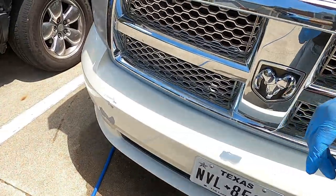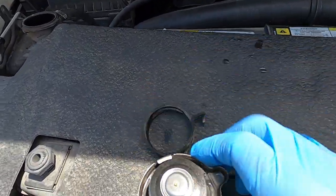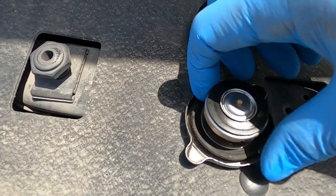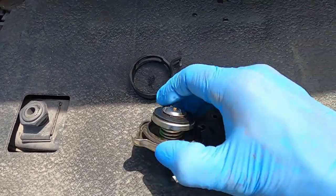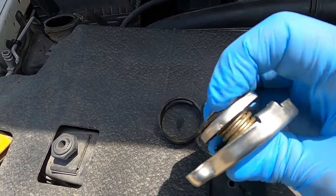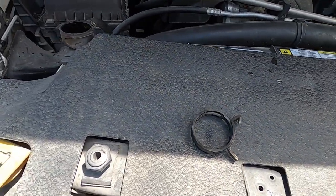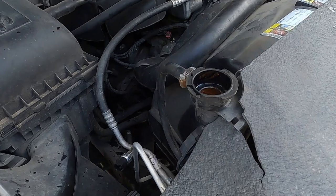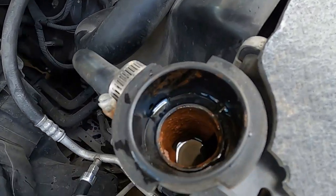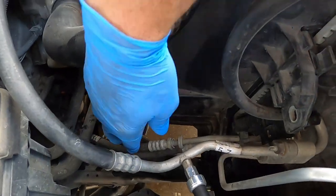We're out here at the truck, I got my hose stretched out. I cleaned my radiator cap up and inspected it — you've got to make sure the rubber's good here and here. If that thing doesn't seal properly, and make sure your spring is in good condition by pushing on it, because that simple little radiator cap will make your car overheat.